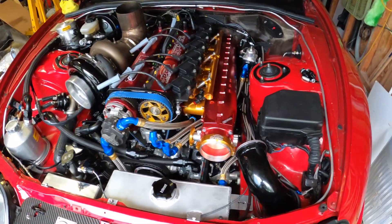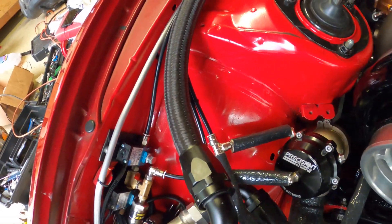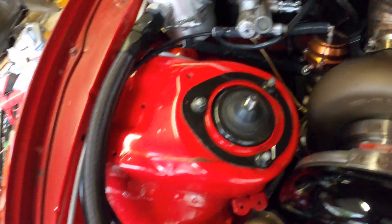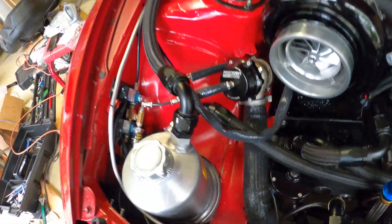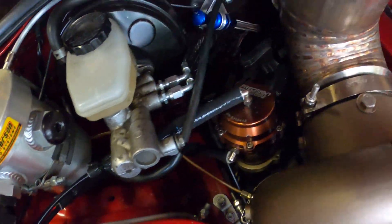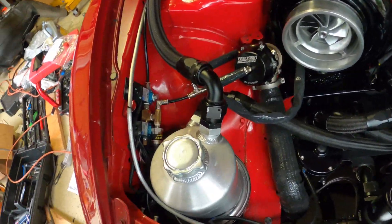There are also coolant holes coming out the middle, so it's kind of weird to put the coil packs on top there. I ran these yesterday — these are the CO2 lines for the wastegate, all from Motion Raceworks. I've got a heat sleeve here to protect them from exhaust heat. The exhaust back pressure sensor is down there, all the gates are done, and the oil has been primed.